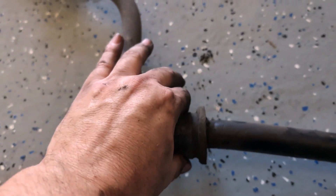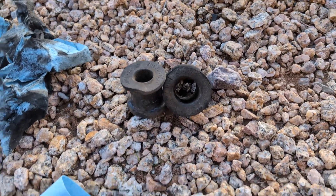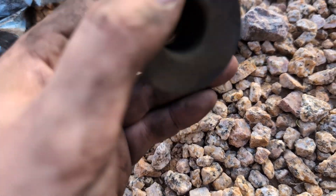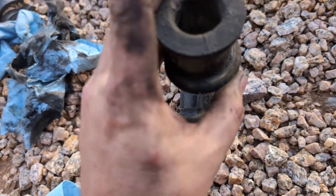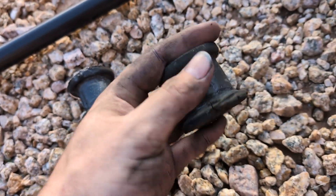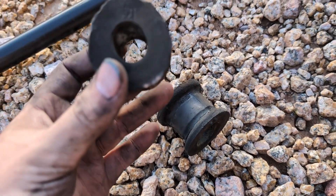Time to go clean it up. Here's the bar all cleaned up — I just sprayed it down with brake cleaner, wiped it dry, and I'll let it dry a little more. Here are the old bushings off the bar. They definitely don't look great, pretty beat up with a lot of cracks. This inner one is just toast, and this side is missing a chunk — the inner one is super misshapen.